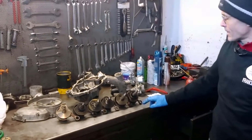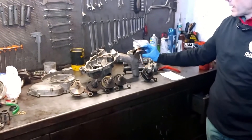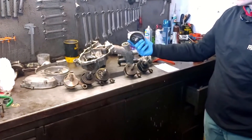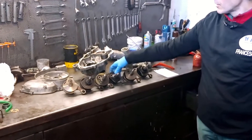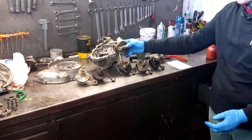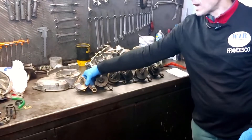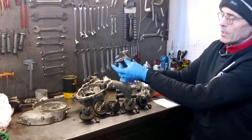Here you see lined up: a shaft of the original Vespa PKS, a shaft of the original Vespa HP50, a so-called aftermarket racing shaft — this one in particular is a Mach-Eur, otherwise there was the MDP which was practically identical. Then a Pinasco, an old one from the 80s which has a resin filling — this was a novelty from Pinasco back then. And then a very used shaft of a Vespa Primavera ET3, and a shaft of the PK125 ETS, which has the same cone as the 125XL, therefore with a bearing as large as the PX — an excellent shaft.